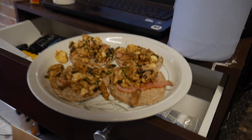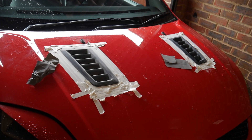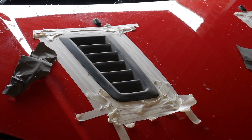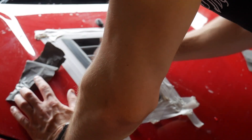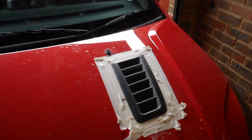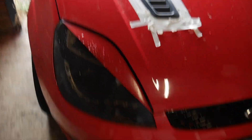Just stopped for a snack - got some rye cracker things with egg, turkey bacon and spinach. Dry sanding seems to take off that clear coat a lot better - don't know why I didn't start with dry sanding. I'm not a professional like I mentioned, but dry sanding does take off the top layer of nastiness a lot better. We're going to go in for the 1000 grit now - the dry sanding has taken it up quite nicely. We'll probably skip the 2000 and just start spraying, because you know, we're doing professional things here.